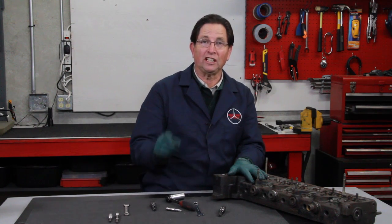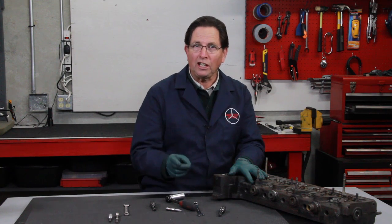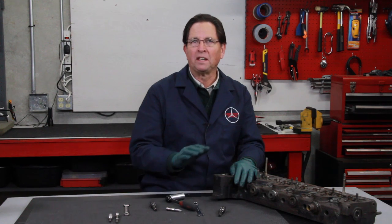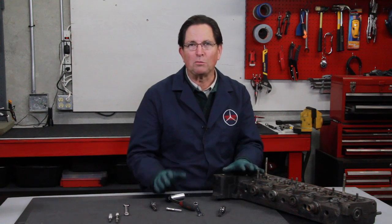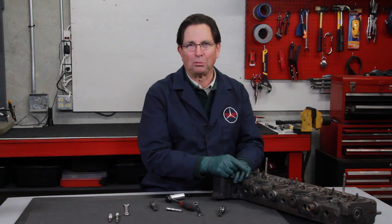With a little care you can successfully do this job yourself, and the results can sometimes be amazing. You can literally increase the fuel economy of your engine, improve starting on cold days, and you'll have much less smoke at startup. So anytime you're messing with your glow plugs, anytime you plan to remove and change them, be sure and ream out the glow plug holes.